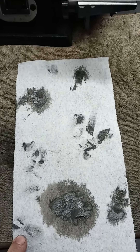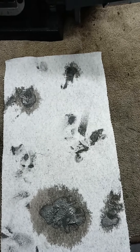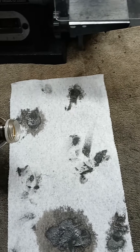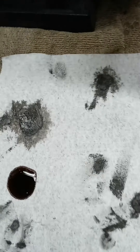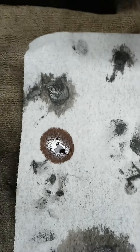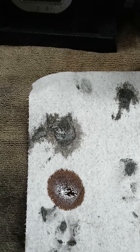When you do that drain plug there's a magnet. There were no chunks or big pieces, but there was a lot of metal dust. I'm just gonna pour a little bit on this white surface so we can see what it looks like — it's pretty dark. You can barely see a little bit of the red tint if you look hard, and it has kind of an old smell, not necessarily burned, but old.